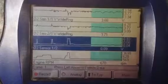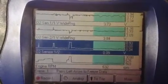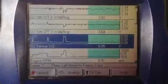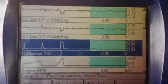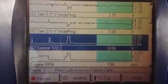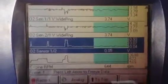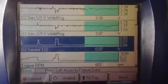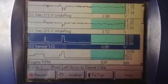So with wide range, the way it operates — that rear oxygen sensor would be really high, meaning a rich amount of fuel coming through or low oxygen, and it's not reburning the hydrocarbon. So you have to base it on doing the math with the wide range value and then compare to what the rear O2 sensor is showing. If it's not reburning, it'll show rich. If it's running really lean and it's not set up the way mine is, then you're going to be showing really lean when there's a problem with the oxygen sensor where there's a restriction with the exhaust gas out of the car.